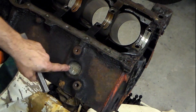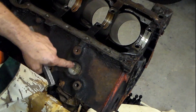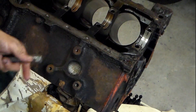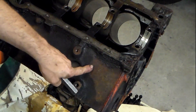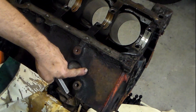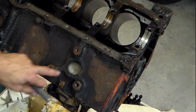Now you're going to be really careful with the procedure I just described, because right here and here are your cylinder walls. I've actually seen someone try to get a freeze plug out, punch a chisel in there, and crack the cylinder — punch a hole through it and damage the block. It basically ruined the block. You can sleeve it, but in my opinion, once you do something like that the block is junk.